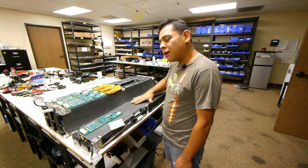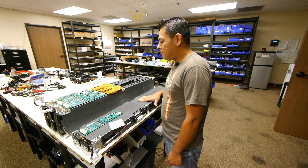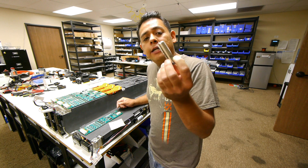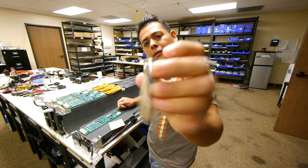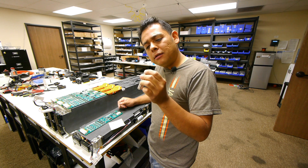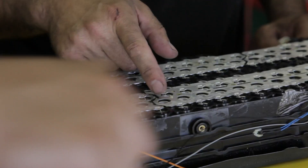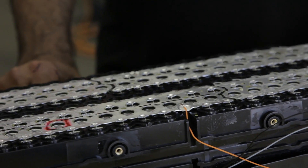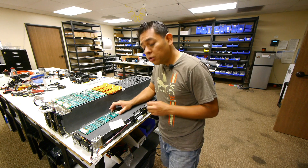I'm going to be installing this in my Samba today just to see how they run. Let's discuss a little bit about these modules. The cells are 18650 and they don't have a lot of markings — just a few little markings here and there, not really descriptive, so we don't know exactly what they are. They are 22P15S — so 22 cells in parallel, 15 cells in series — and each module contains 330 cells.